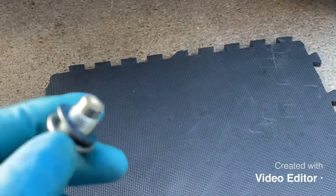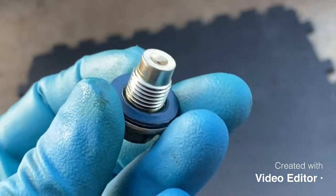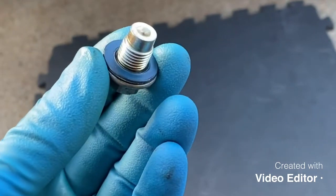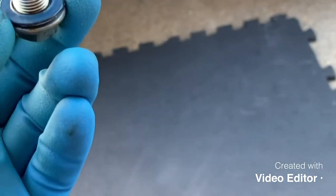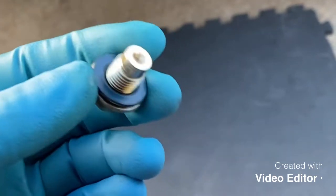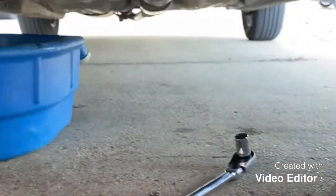Alright guys, now the oil is drained. This is the oil drain plug with the gasket. I used the same gasket that was in there — I took it out, cleaned it and I'm going to put it back in. I usually use the same gasket two to three times; it won't hurt and I never have any oil problems, but it's up to you. You can look at the condition of it and you know your car. Now we're going to put it in and snug it up. The owner's manual says 34 foot-pounds, but I usually just snug it up — never had a problem. You can see the oil drain is good; no more oil, just a tiny tiny drop.